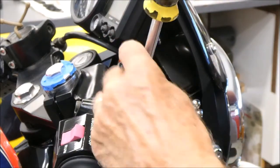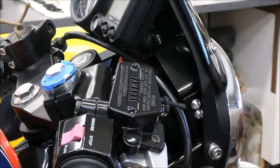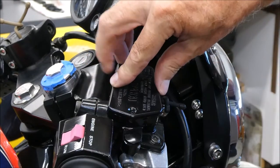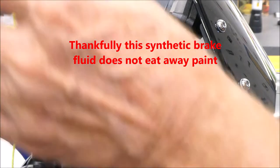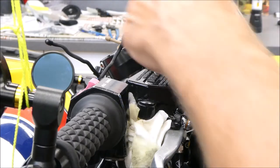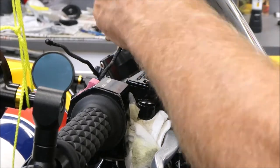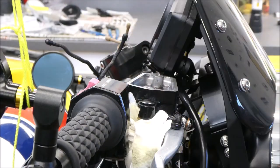Next, take this cover off. Big spill — I thought there was nothing left in there. Moving to plan B. I just tied this clip up with a string tied to the ceiling so the master cylinder is fairly level right now. That's better, no spillage.